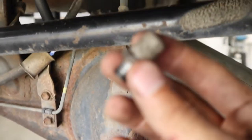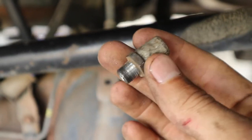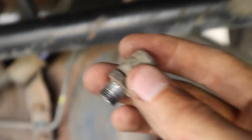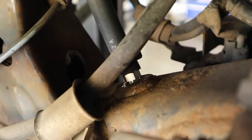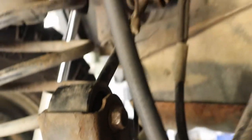So far I took out the old breather. I gave it a quick wire brush to make sure no dirt falls in — it was a 14mm and came out no problem. Then I put in the new fitting, which was a 12mm. I slid the hose over top and put a zip tie on there really tight. A hose clamp is probably a good idea but I think a zip tie will be okay. So I put that on and ran it up here.